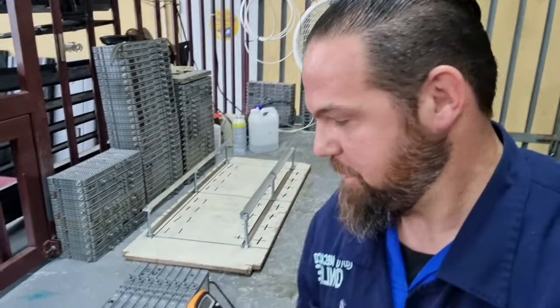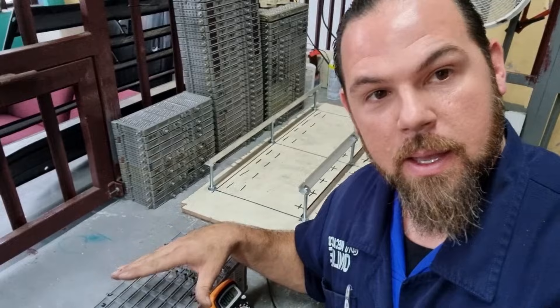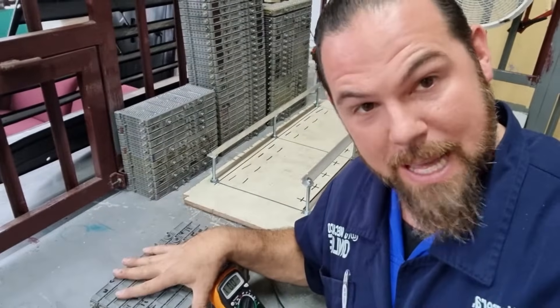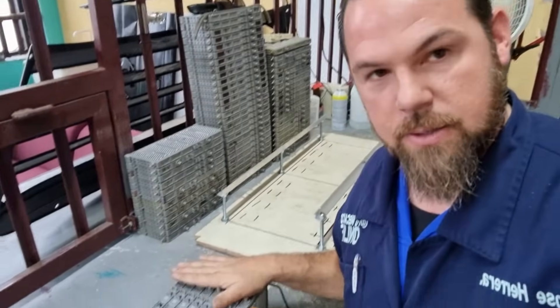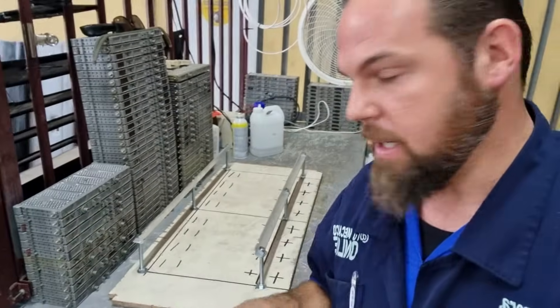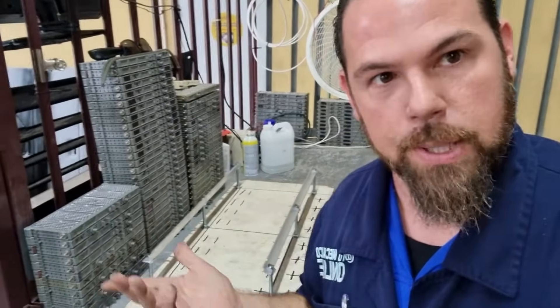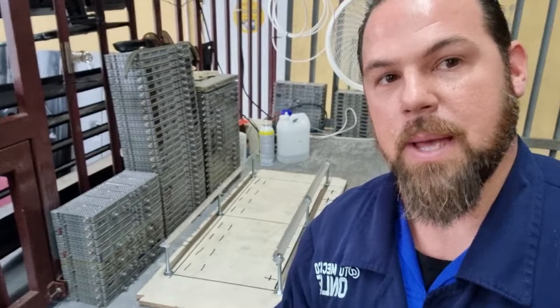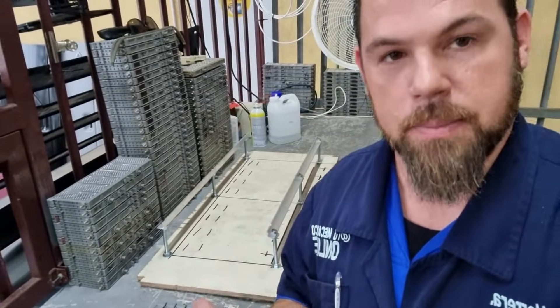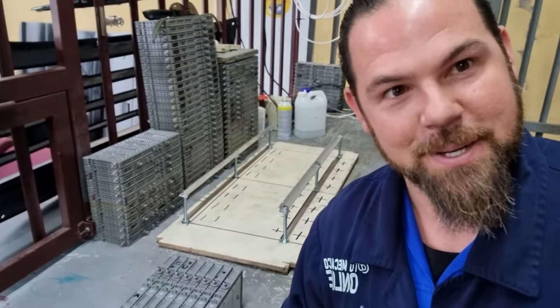In less than 10 minutes — super fast charged. Now in order to load test them, I need to balance them first so I can properly graph my load testing. So I'll just leave them in the balancer connected for at least one day, so they will be perfectly balanced by tomorrow, and then I can properly do my load test. Very easy, right?